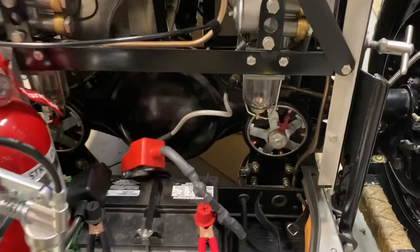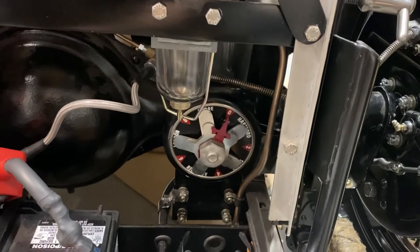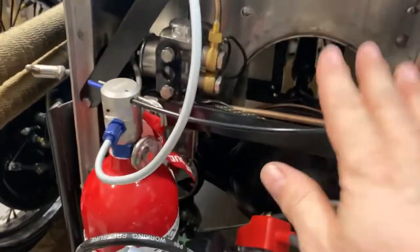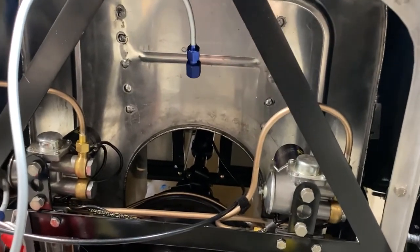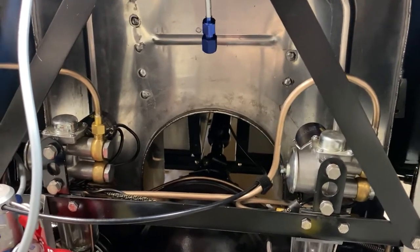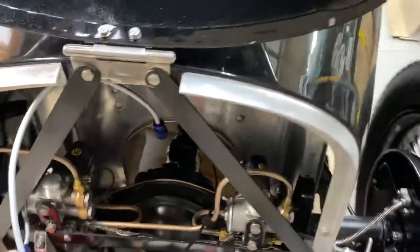You've seen these shapes before up front — these friction dampers are mounted inboard because there's not a whole lot of room back here, and that's traditionally where they put them on the back. We've got two fuel pumps with their respective float bowl filters — sediment bowl filters — down here. We have a fire suppression system plumbed in three locations: one back here by the fuel filters, one in the cockpit, and one on the supercharger out front. Those are the three areas where we protect the passengers and the two areas where fuel is concentrated. It may not entirely extinguish 12 gallons of fuel, but it will buy us time to get away from the car if we have a really bad day.